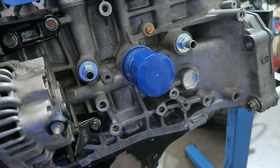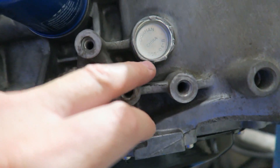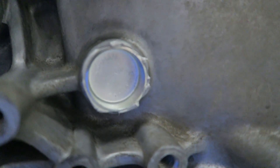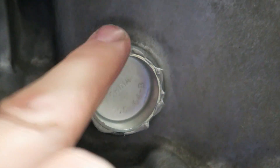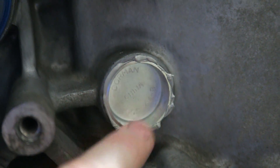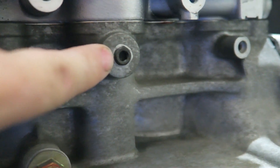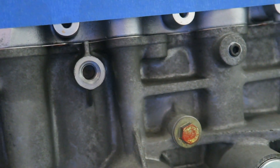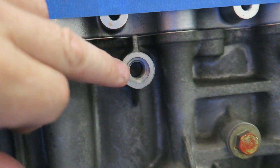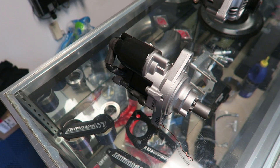A new oil filter, and this plugs up the oil separator that was on the motor. It's a freeze plug — here's the part number — it fits in there pretty tight. A good smear of Honda bond around it, push it in until it's level, and it's good to go. You'll also need to cap that with a one-eighth pipe plug — again Honda bond around it, there we go. We have the breather sorted. And there's the knock sensor, which we put on at the end because if you look at it and shout at it, it will break.